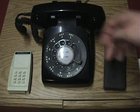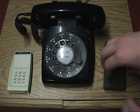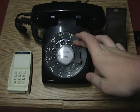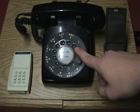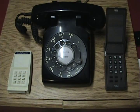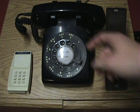What you see in front of you here are pocket tone dialers. These use DTMF, which is known as dual tone multi-frequency. If you look inside here and on here, there's a dial with buttons. That's opposed to this rotary phone dial, which just has a spin — you would dial by spinning this knob. The main difference is that this rotary phone uses pulse dialing, which is done by switching the telephone line on and off in a series depending on which number you dialed.